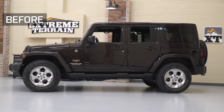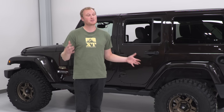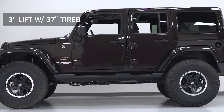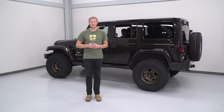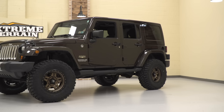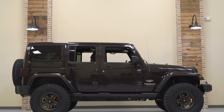We got the Jeep on the ground with the 35s and the lift installed — it looks really, really good, even better than with no lift and the 35s. It's proportional and it's going to work really well, eliminating those clearance issues we had before. We also threw a set of 37s on with this three-inch lift kit, and honestly they're just a little bit too big — you end up running into many of the same clearance issues as with 35s and no lift. The three to three-and-a-half-inch range is really the perfect lift for 35s.